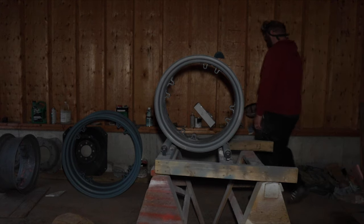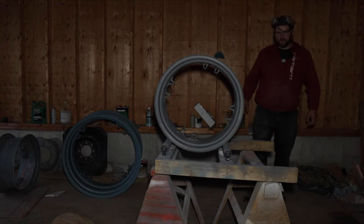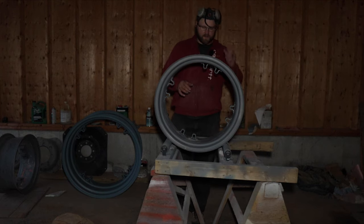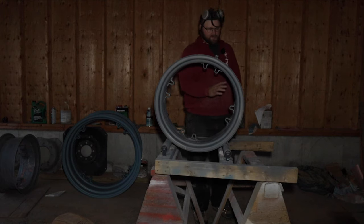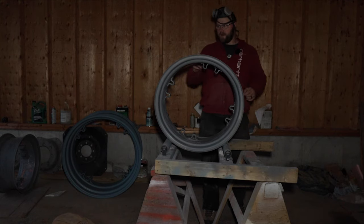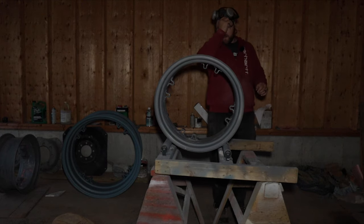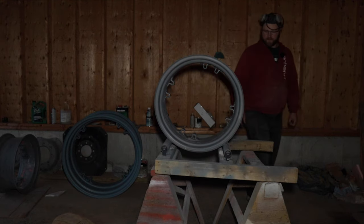It's just high build, so if it gets screwed up a little bit it's not the end of the world. When I clean these rims off I use shop towels and brake cleaner first, then I wipe them down with grease and wax remover — a pre-paint prep — and lint-free towels. I'll paint one, move it out of the way, wipe up the next one, paint it, move it out of the way. I've got about three-quarters of a cup of paint in the gun. I'll flick it to time-lapse and let her rip.